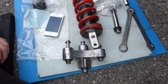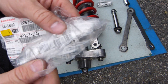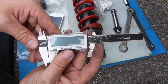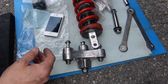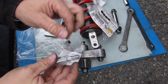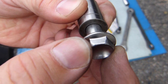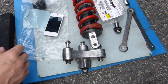So I went ahead and cleaned everything, took my measurements, and in the meanwhile ordered new bolts and sleeves. When they arrived, I found that the new bolts and sleeves are exactly the same size as the old ones. Granted my measurements were taken with only a digital caliper, but close enough is close enough. If they are microscopically not different, they still have a clearance of 0.35 millimeters. So I'm not going to install these — I'll just keep them in case something catastrophically fails.